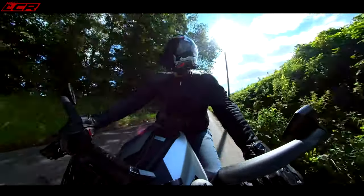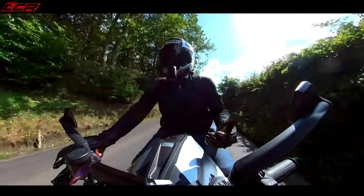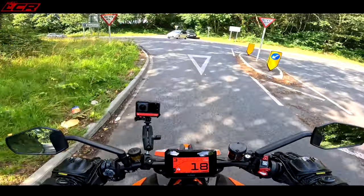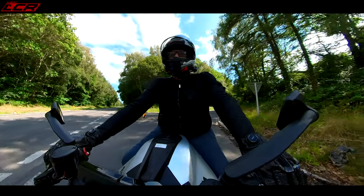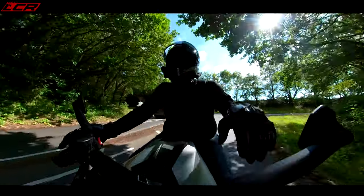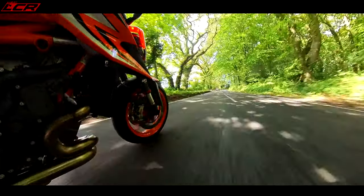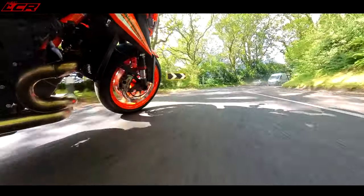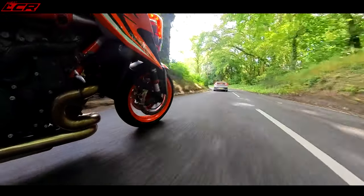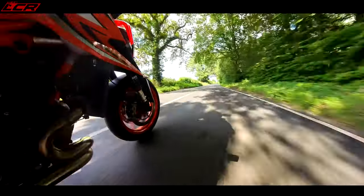One of the fantastic things with this bike — I think the thing which is almost as impressive as the performance — is how tamed this engine is at lower revs. What annoyed me about my Gen 1 was the fact that anything below 3000 revs was unusable. It would rattle, it would shake. Riding through town became a real uncomfortable experience. But on this new version, where they've added balancing shafts, anything above 2500 upwards, it's perfectly smooth, perfectly usable. The days of massive V-twins shaking your fillings out has completely gone. And this is so nice to ride at lower throttles now.